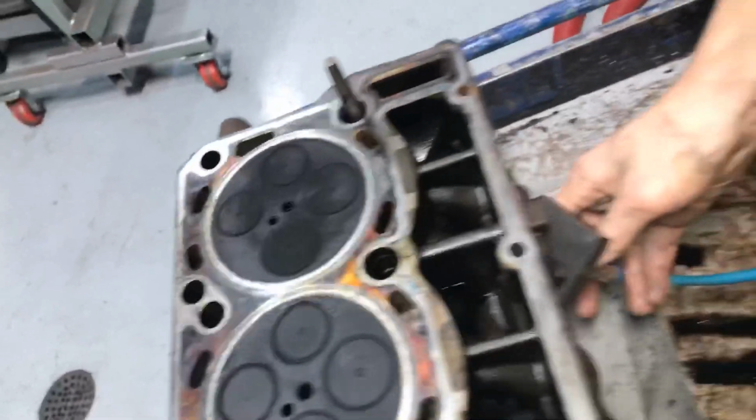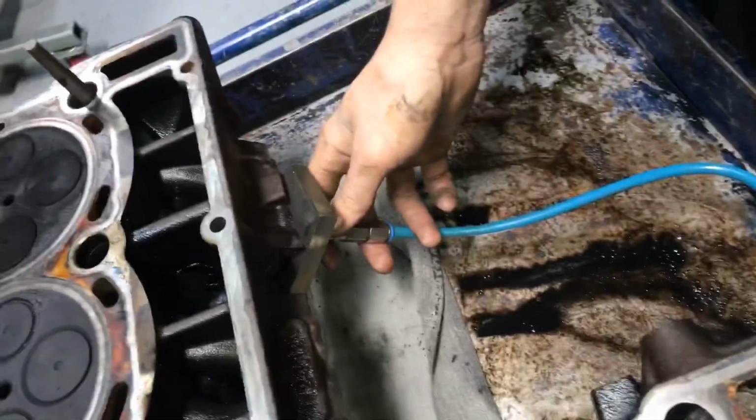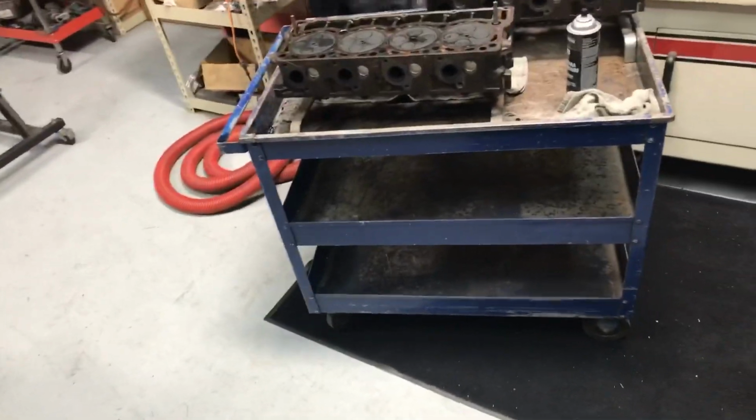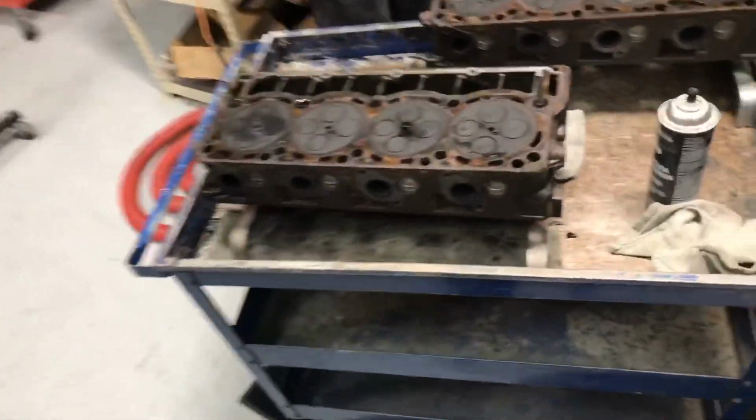Okay, this is the old head. Check the other one. All the way good. Okay, so the valves are good, so we're not looking at a valve issue. So honestly, engine out, unless, I haven't quite looked at the injectors yet either. We'll look at them, clean the nozzles up. Go find number 1 injector and clean the nozzle real quick.